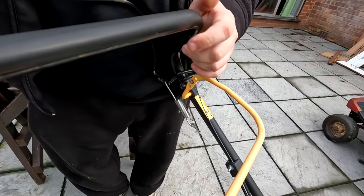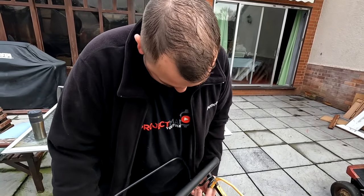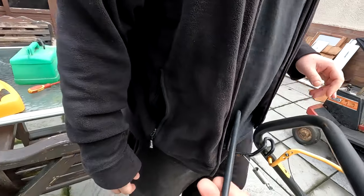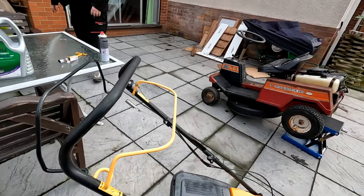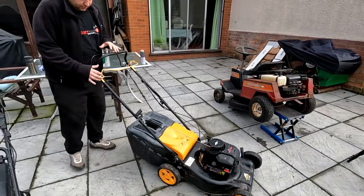We just found out why the McCulloch was hard to start — the drive was automatically engaged. That's the reason; it needs adjusting. You've got three little holes on these McCullochs. It was on the highest one, so we'll just drop that spring down to the lowest one. It was well engaged — that's why it was hard to pull over, nothing wrong with the engine. That's why I'm ahead of lawnmowers — I taught you, haven't I?